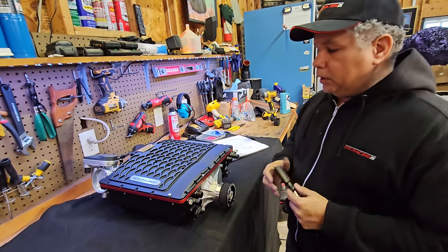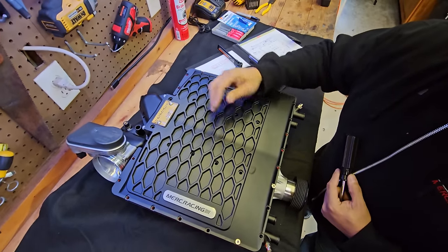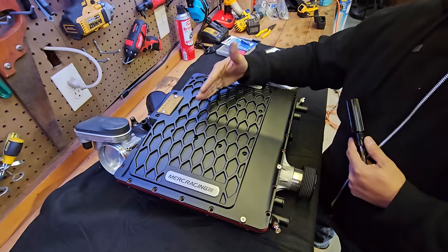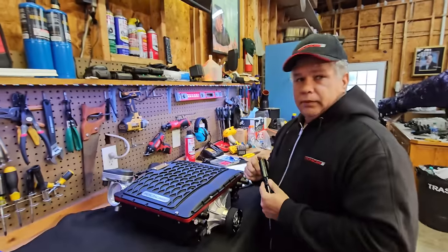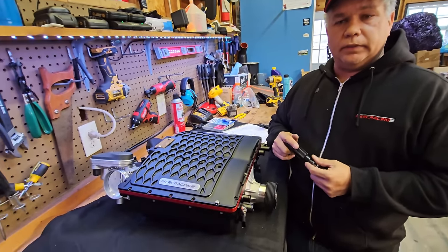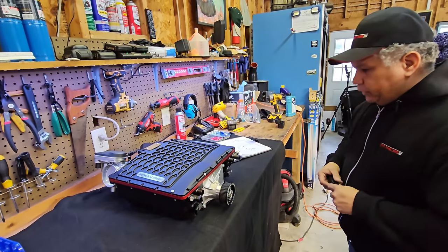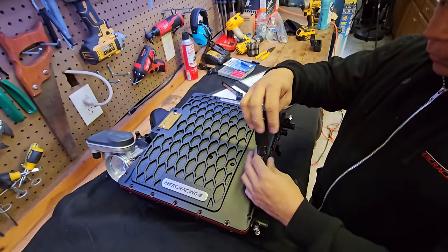The directions shipped with the unit include a bolt diagram for the top end for reference. The outer perimeter bolts are 20 millimeter and the front ones are 12 millimeter. Once the top hat is removed, the intercooler cores are pre-assembled with bolts already installed. Use your tool of choice, remove them carefully, and package and label them so you don't mix them with anything else. There are no gaskets for the core because the CNC machining closes everything down really nice — the core just comes right out.